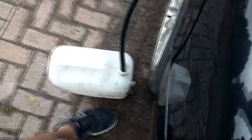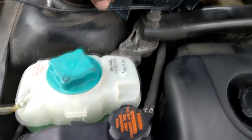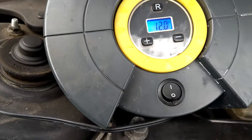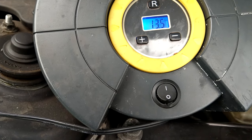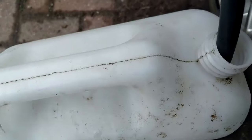Because I'm removing the cooler, I need to reduce the coolant level in the car. I'm using my tyre compressor, pumped up to about 16 PSI, forcing air into the expansion tank. It comes out of the return hose, giving me around four litres of coolant out of the system. You can also drain the system the standard way by pulling the bottom radiator hose or undoing the drain tap at the bottom of your radiator.